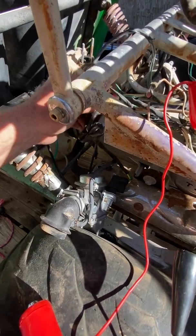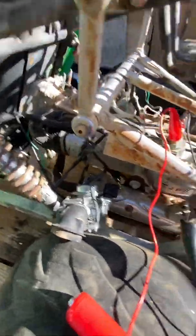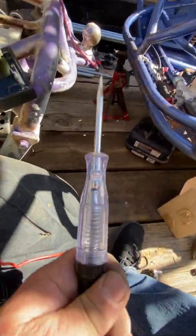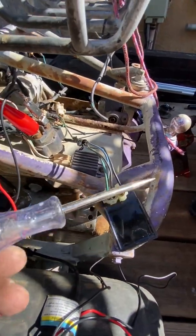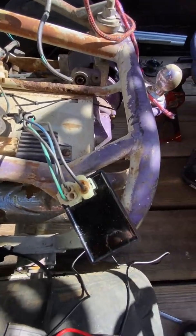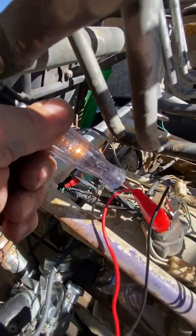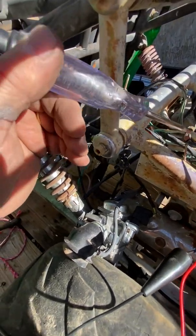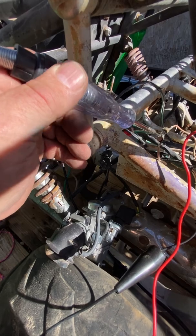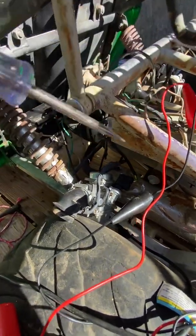You want to look for a plug that's got power going to it, and you can always use your test light to do that. I have a simple test light that I use to test stuff, and I usually keep it plugged into the negative of the battery so that I know that everything I'm doing is going to have power. First thing I want to do is check to make sure I have power running to the positive side of the battery. I've got power going there, so I know I've got power coming through the fuse. I've tested all that — you can see I'm checking power with everything. Now that I know I have power going through the whole system, there's power going there.